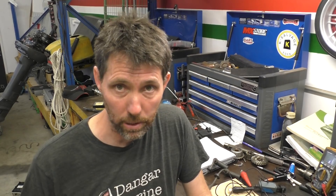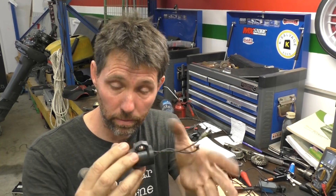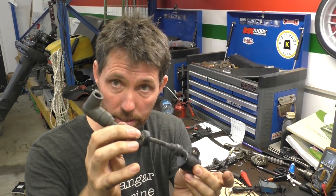That's all kind of nice in theory, but probably not something you really need to know in order to install them or get your outboard working. So let's go into a few of the simple practicalities. As we touched on in the spark plug video last week, there's two main types of coils you'll see on an outboard: a single coil with two input leads from the CDI and a single HT lead out.